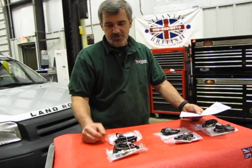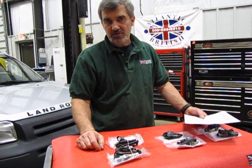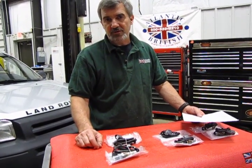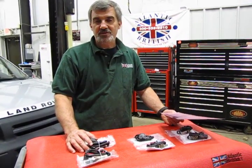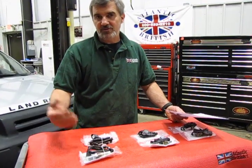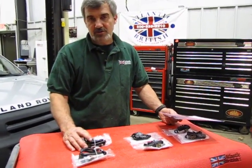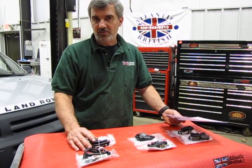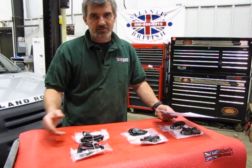I usually find O2 sensors somewhere in the 100 to 120,000 mark. They usually have enough buildup on them where they are slightly deteriorated. The O2 sensors are important sensors in this system because they are used to help regulate the fuel mixture in the engine to give you optimal fuel economy and power. So should they get coated and are not as accurate as when they were new, it can make a difference in your fuel economy and your drivability.